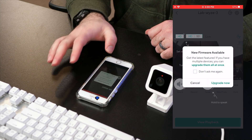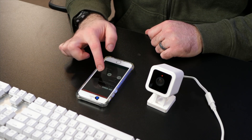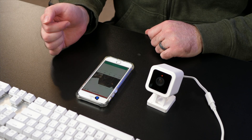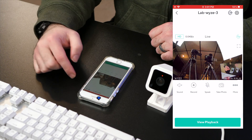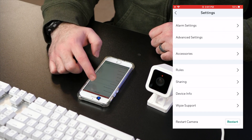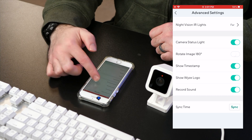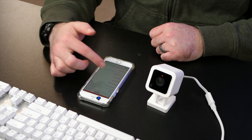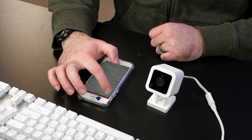It's going to ask to upgrade the firmware — we're not going to do that right now because we are going to a different firmware altogether. If we click the gear icon and go to advanced settings, there's no spot called RTSP. There's no way to put in a URL or username and password to create an RTSP URL. But that is going to change.